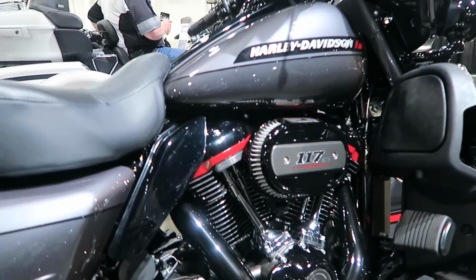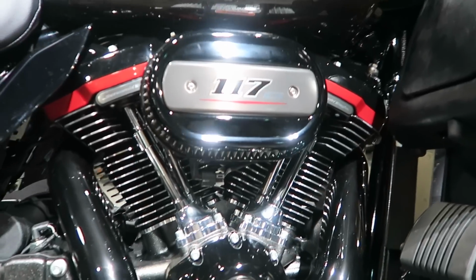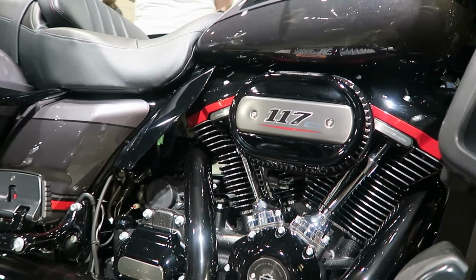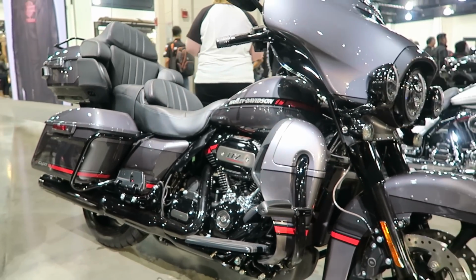When that might happen is if you're downshifting rapidly, or if you're on a really slick road and you have the throttle open and then you close the throttle all the way real quick and you have some engine braking that causes you to lose traction. That's when the drag torque slip control will pop in.